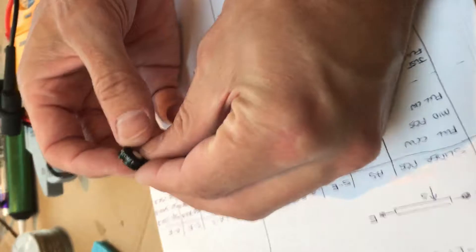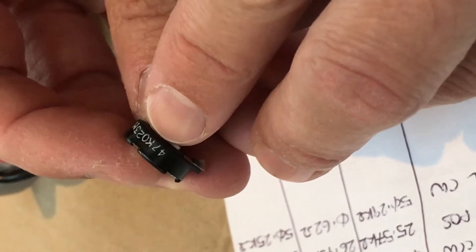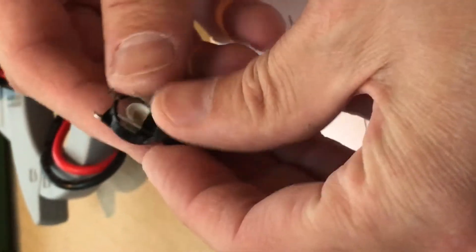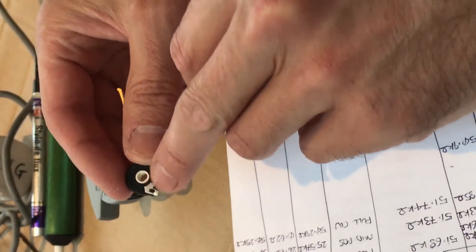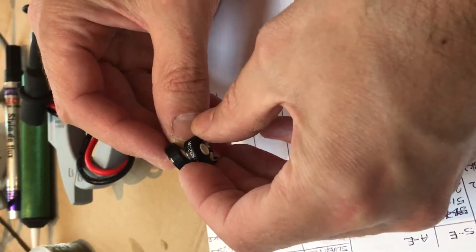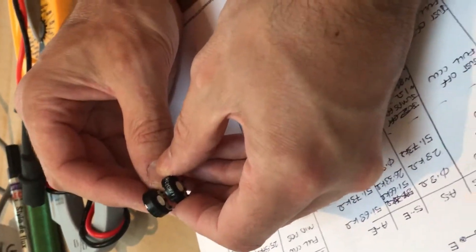This is the one I've just taken off the fridge side of the circuit board — the control board — which says it's a 47K 023M. This is my replacement one which I've bought. The size is identical, the pitch is identical. The reason this one looks different is because I've chopped the legs off just to get it off the circuit board and desolder it easily. This one has written on it — it's really difficult to see — but it says 47K 907M. So it's still a 47K, which is the main thing; just 023M for the original and 907M for this one.